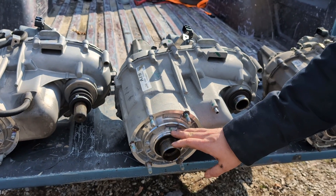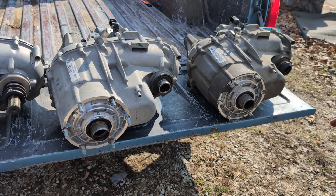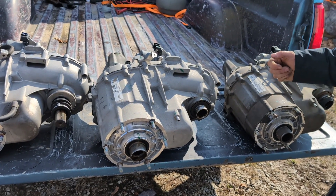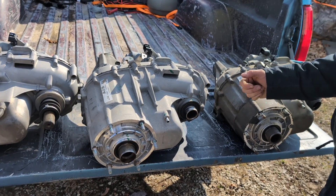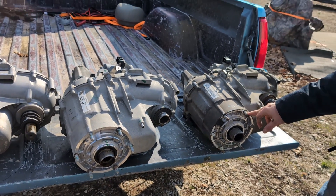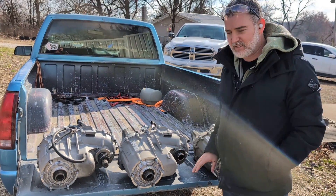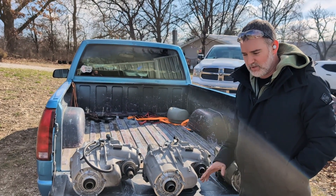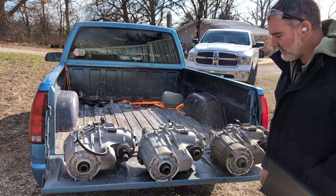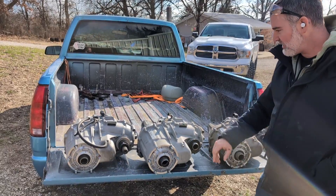This design is slightly different, but the rest of the T-case is identical from a 6-speed to 8-speed. A 6-speed T-case would not really fit on an 8-speed or 10-speed. I did have an 8-speed T-case on my 6L80 without any issues, but there could be issues. I didn't know about the differences until I got a bunch of T-cases in, so that's what you want to look for — check these input gears.